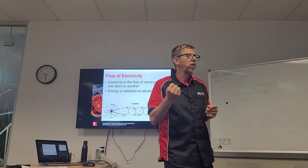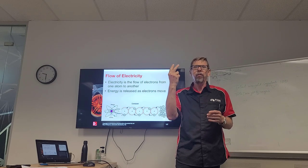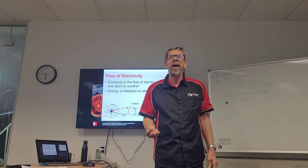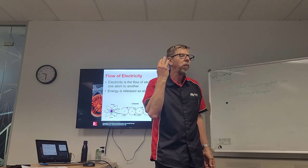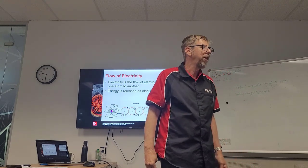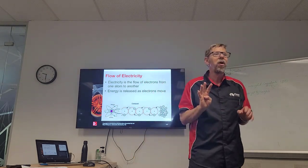We can have an open circuit. We can have what's called a short circuit, a short circuit to ground, okay? Or we can have a short circuit to power, where something's powering up and the switch doesn't turn it on or off. It stays on all the time. Or we can have high resistance in the circuit. So four things, that's all. So we'll cover that, but that's just something to keep in mind.